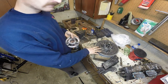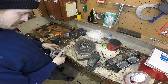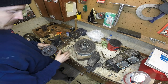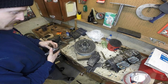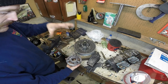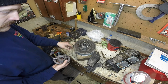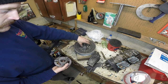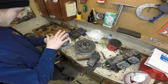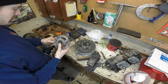Well, step one is to remove your secondary and get it tore apart. You can look up sled tip 002 on taking one of these apart, cleaning it and reassembling it. Go over how you wanna leave the helix loose until you got the cap and the spring compressed back on there, torqued down, and then you go in and torque the helix. That's so that the helix is in good contact with your rollers on your cap, roller cap, plate, top plate, roller plate, whatever the hell you want to call it.